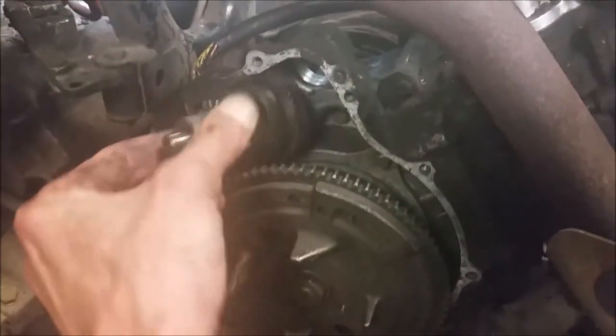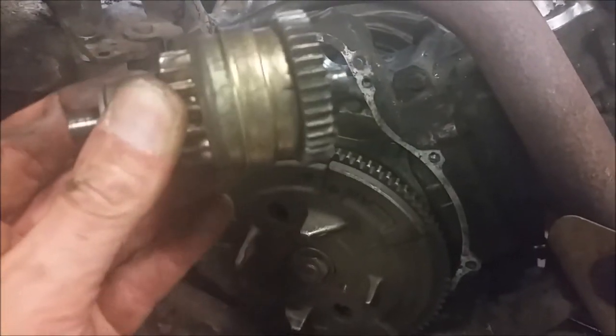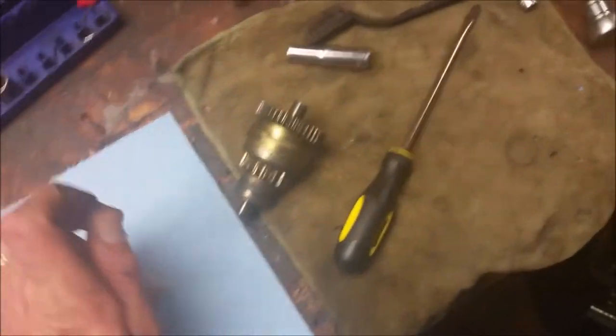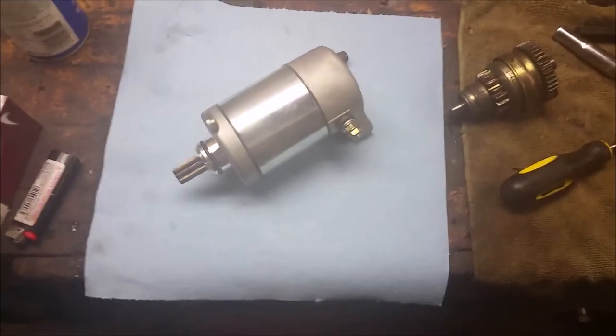With the starter out, I just rotate this and pull it out. This is okay, but seeing I got a new one with the kit, I'm going to replace it. Put a little grease on there, tap that in — there we go. I'm going to get my new one. I actually had to leave this bolt in because it was just a little bit too long, so I'm going to leave it halfway in and shove this back in. Before I do that, I'm going to put some grease around here so it's able to slide in and out. With this all greased up, I even greased up the gear and the bolt right back here.